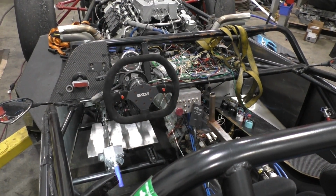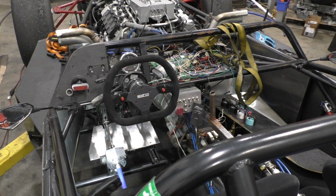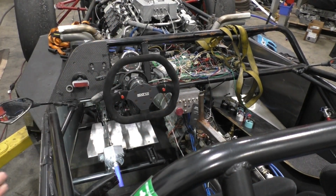And it'll do its checks to make sure that the system's in neutral and just re-actuate the clutch. To get into first gear, as a safety, we need to manually actuate the clutch just with the foot. That makes sure if the car's running in idle, we don't accidentally shift into gear when we're not ready. So right now, I'll just manually push down the clutch. And we've shifted into first gear.